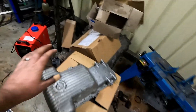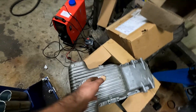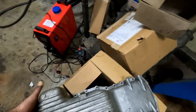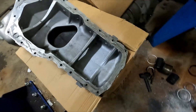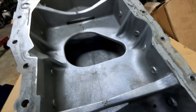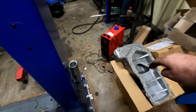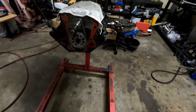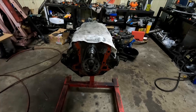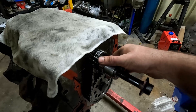Last night I came in and cleaned and modified the sump — it's now got a baffle in it, about here. I should be able to show you guys. Still has some water in it down in there. You can see a quick little baffle in there — that's just to stop the oil running forward when you jump on the brakes, which these things seem to have a problem with. And I got the double-row timing chain all fitted up with the oil pump drive.